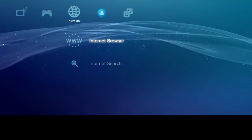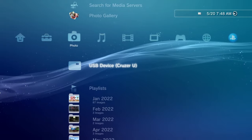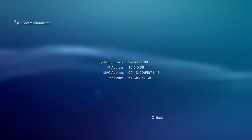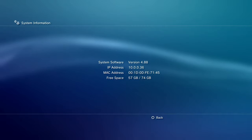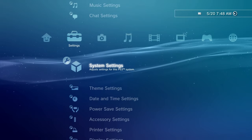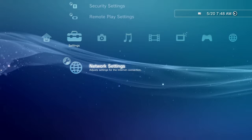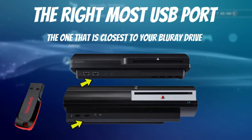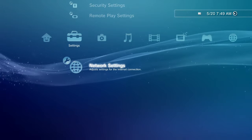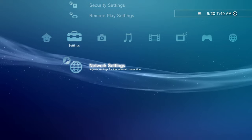We are back on our PlayStation 3 device. Let me go to system settings — I am currently on HFW 4.88, and my goal is to get up to HFW 4.89. So if you're updating to hybrid firmware from another hybrid firmware or going from OFW, you can follow this guide. Make sure your USB is plugged into the rightmost USB port on your system — basically the USB port closest to your Blu-ray drive. On original PS3 systems with four USB slots, plug it into the fourth slot.